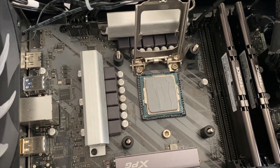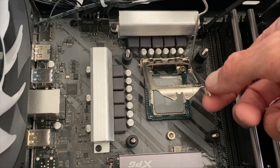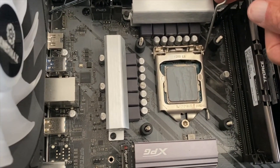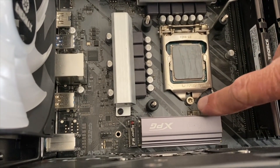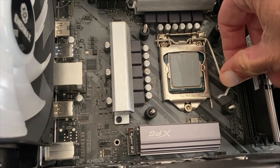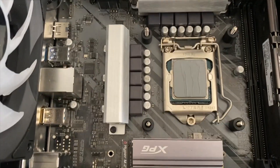I've got the new chip in there — you can see it's got the thermal paste on it. So what you do is you lay this part down. As you lift this lever, you can see it drop into place and it's going to slide underneath this screw here and hold the chip down. As I push this lever down there's a lot of tension on it, and what it's going to do is hold that chip very tightly against the conductors.